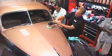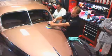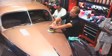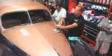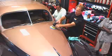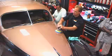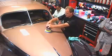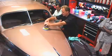If you put the pressure down here, you buff crooked, the pad quits rotating. So put all the pressure right up here. Now these things come with a handle, and I always take it off because when you use the handle, you tend to buff crooked because the handle's sticking out like here, you push down on it, you're buffing crooked again. So it's just as easy to put your hand right up there on the head. Okay, I think this is what, 5 or 6?